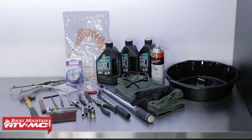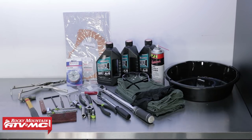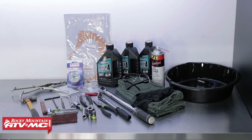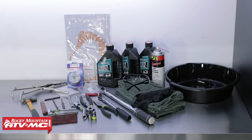To do this job we're just going to need a few basic hand tools. You will want to have a clutch holding tool, a hammer punch, gasket scraper, some high strength thread locker, as well as a drain pan, safety glasses, rubber gloves, contact cleaner, and some rags. We will be draining the oil today, so you will want some replacement engine oil, and it may not be a bad idea to pick up an oil filter and a replacement clutch cover gasket.